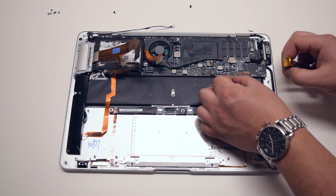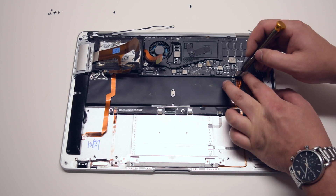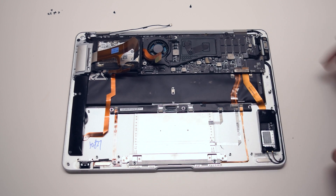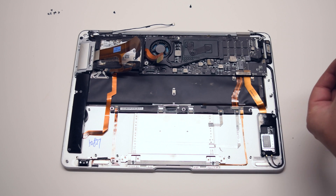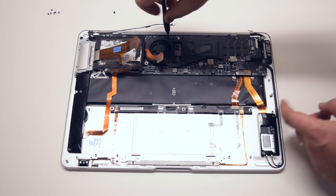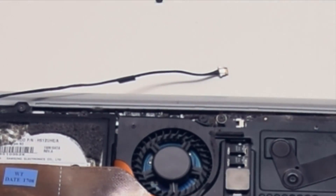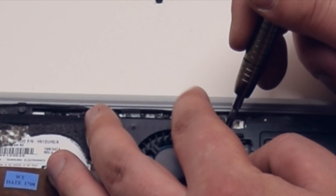Reinstall the trackpad, keyboard, and Bluetooth retainer — this is sometimes difficult to do as the screws are extremely tiny. You can now reattach the fan with those head screws, and install the remaining bottom right corner logic board screws. At the top of the fan, go ahead and reconnect the iSight cable. You can do this by aligning it and gently pushing it in with a screwdriver.